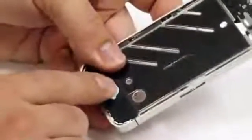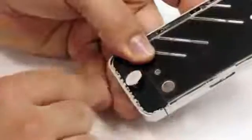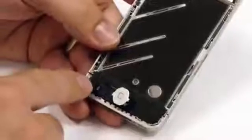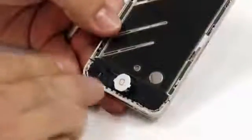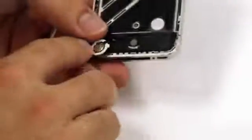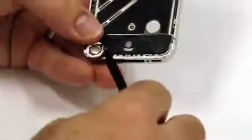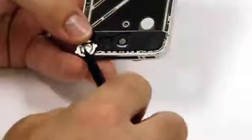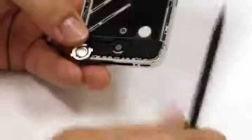Test the button and make sure it has a normal clicking feel to it. To recap: you do have to take the LCD screen off and the circuit board off to change out the home button. Basically you peel it back towards you, take your black tool, and carefully separate the flex cable from the plastic home button, then reattach with the new color of your choice. That's the iPhone 4 home button replacement.